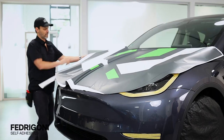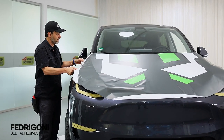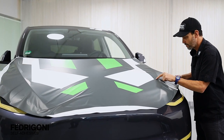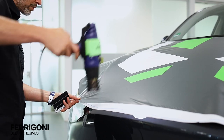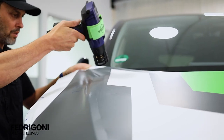Once set in the middle, firmly remove one side of the panel, pick up the panel, and stretch it lightly to the side to make it as flat as possible. Repeat the same steps for the other side. One thing to note is that ReJet has a unique ability to relax flat to the surface by adding heat in overlapping strokes, which helps make the wrapping process much easier on the installer.